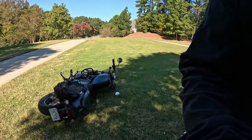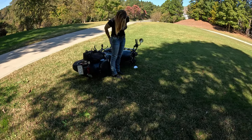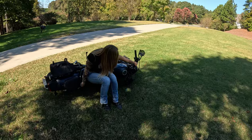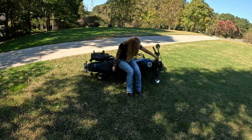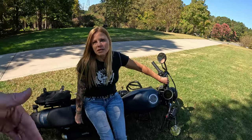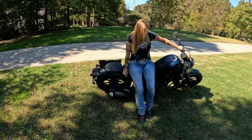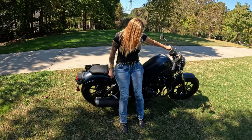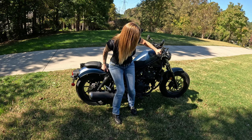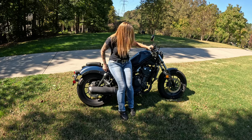I'm not going to do it — I want you to do it on your own, because then you'll have the confidence to know you can do it. You've got to get really low. Grab this one right here, grab the handlebar, and start standing it up. Keep going. From there, keep holding it and scoot your butt down a little bit, then keep pushing backwards. The kickstand's down, so the bike's not going to fall over on the other side. Keep going all the way up till it gets on the kickstand. It feels like it's going to go backwards — it won't. There it goes. It feels like it's leaning — it's on the kickstand. That's how far it leans.